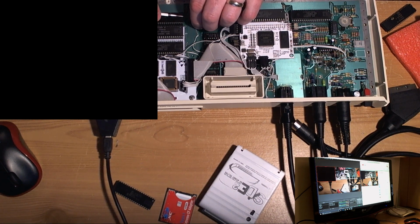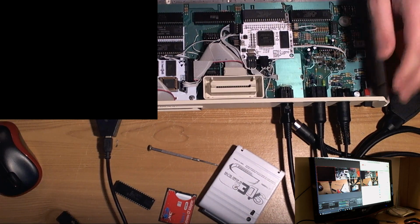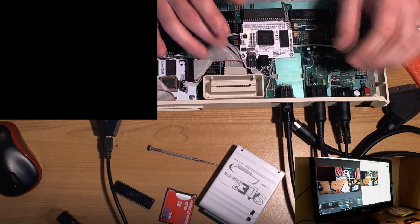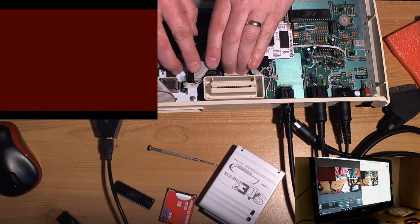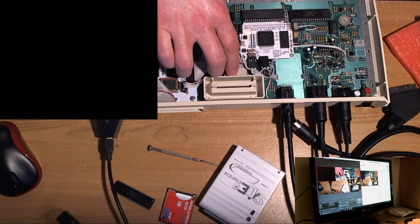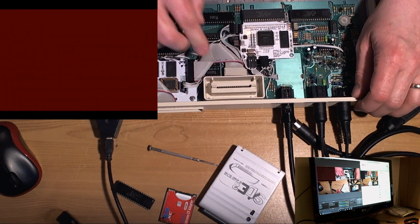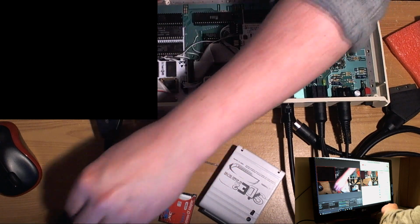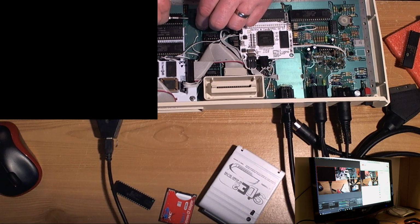Check the plug going into the MMU socket on the motherboard. I thought I saw a blip when you caressed around the cartridge guard. Oh, okay, let's do that. I definitely saw a blip, but I couldn't remember for the life of me what had caused it. So let's have a look. Press down on there. Press down on here. It's always worth a try. I hate these cables, but let's try a quick CPU swap, just in case we've had a spontaneous death.